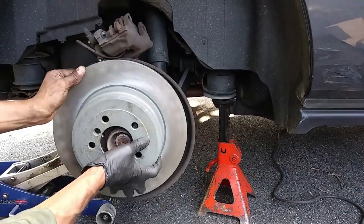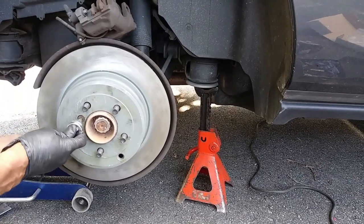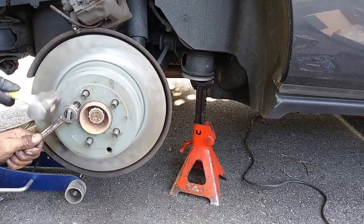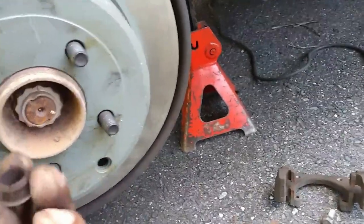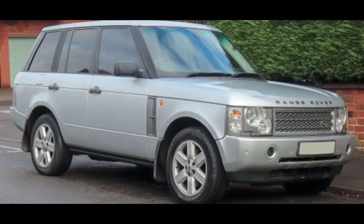I'm going to get the new rear rotor. Make sure your holes are lined up — there are two holes on this rear rotor. One is for the park brake adjust, the other is the bolt that holds the rotor to the bearing. Get that back on nice and tight. That second hole is for the park brake adjust — these two holes won't line up with each other, meaning the screw and the adjustment hole won't line up simultaneously. There's a cap that covers the park brake adjuster — I popped that cap out and I'm going to reuse it for the new rotor. The park brake does generate dust over time, so that little cap also helps keep dust from getting into the rim of the car.